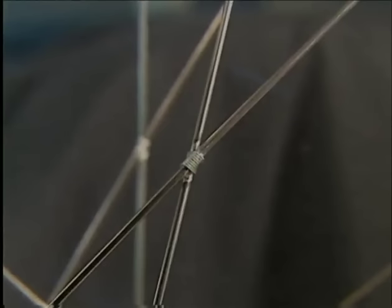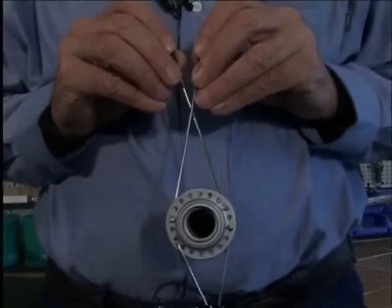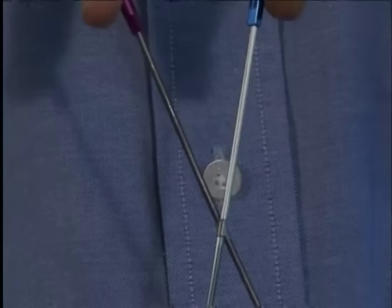Now we begin the highlight of wheel building, tying and soldering the spoke crossings. Anyone who has a command of this, who can conjure perfect tied crossings, all exactly alike, is a master of the art of wheel building. The mission of the wheel builder, as we've already said before, is to increase stability in the crossed spoke structure. Tied and soldered spokes no longer move against each other, and the result is a solid unity of hub, spokes, and rim.